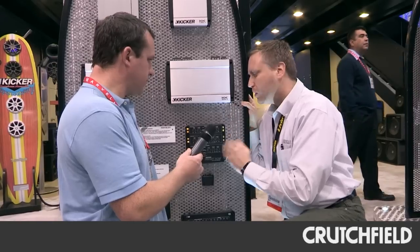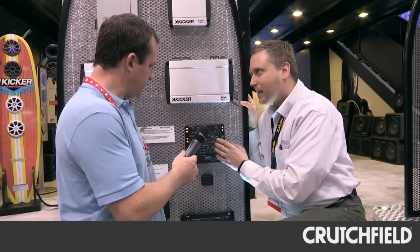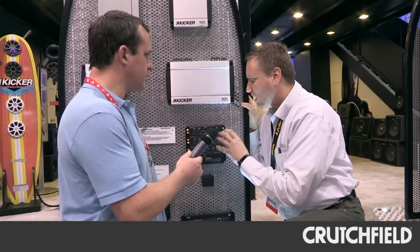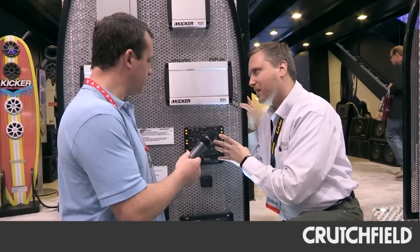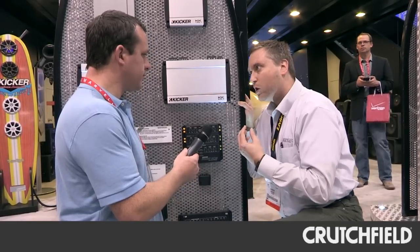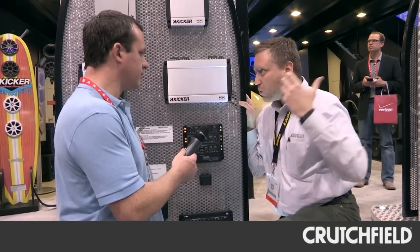It's like a brick wall filter with 48 dB per octave cutoff. In addition, it can run a full active crossover system — tweeter high pass, mid-range band pass, and subwoofer low pass — so you can do a full active crossover with no passives in your system. On the subwoofer section, we give you a variable phase adjustment. This allows you to make it sound like your subwoofer is not in your trunk, but right on your dash where it belongs — it takes the bass out of your trunk and moves it up front.